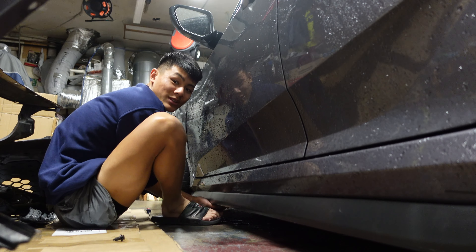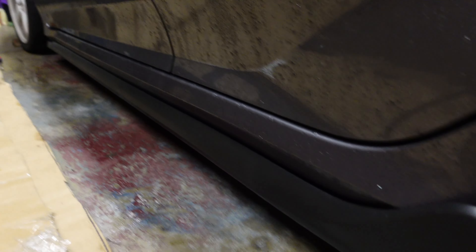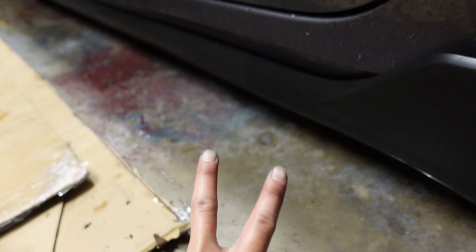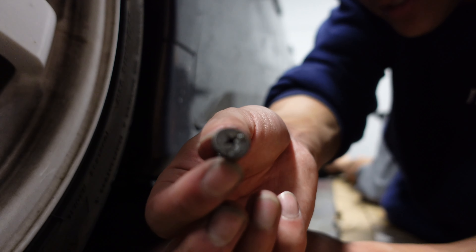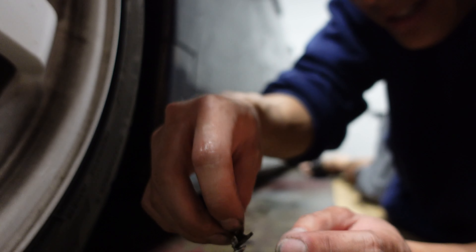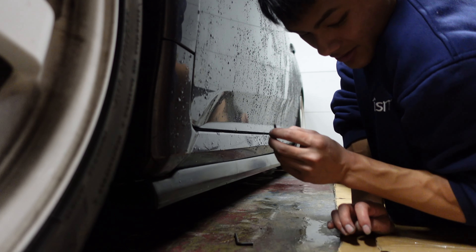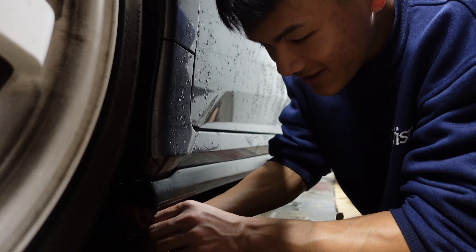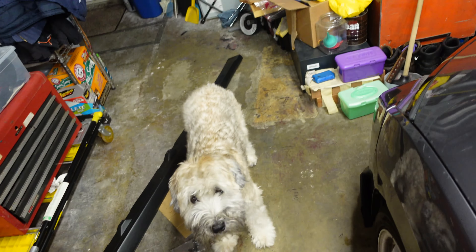These clips are pretty bad — pretty ballsy not doing 3M tape. I got the first side skirt on with two of their clips and one OEM one. Now I'm going to screw in one at the rear and one at the front. I just removed the existing screw from the front — the silver one they provided is a bit shorter, so I'm going to use the OEM screw to make sure things are good. Looks like I'm going to need to drill a hole — hand tools are not doing the job.